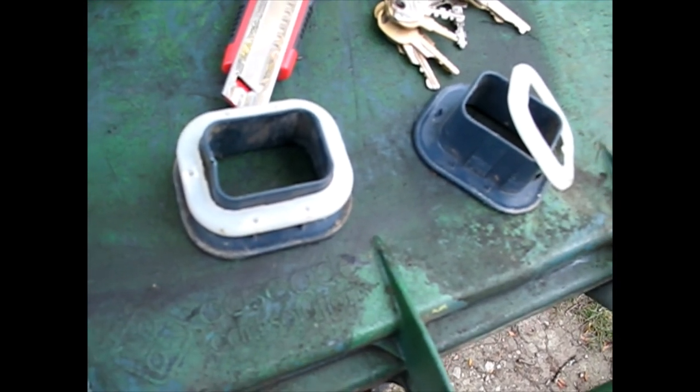But anyway, the last thing I got is the seatbelt things, and they got some little barbs right here, and you stick this through the one side, and use this as a washer, and as you push, it'll pinch the seat material in between itself and make a finished look. So I've just got to try to cut as carefully as I can, because I don't want a big rip or a big hole in my seat.